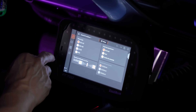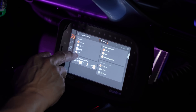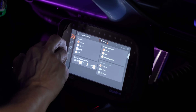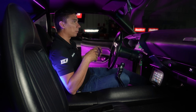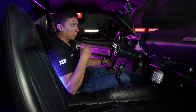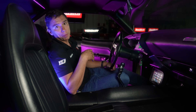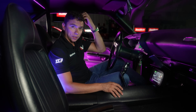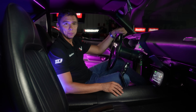For each O2 channel I can choose the sensor type: Bosch 4.2, Bosch 4.9, Bosch 5.2, or NTK — and do the calibration right there on the dash. The cool thing is that as we've been using, developing, and testing this system, we've been constantly adding features. Everything from the FT Power line and more is in here.